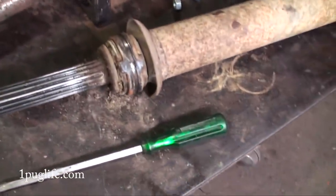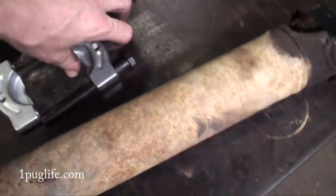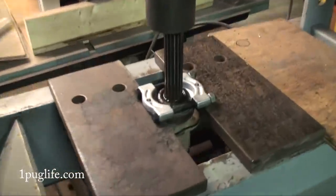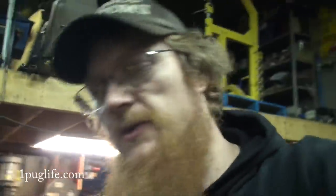If it's not three things it's eleven. From what I can tell you just tear off that outer rubber and the bearing is right there — but of course my bearing puller is a little miniature one, it should not fit. So yeah, that's less than ideal. I guess we'll come up with plan L. Short of turning something on the lathe and cutting it all in half and drilling it and all that kind of stuff, I think we're just gonna have to zoom the outer bearing housing right off of it, and it's just gonna turn into a situation where we could have just left it on there and changed the outer housing and just snapped that U-joint off.